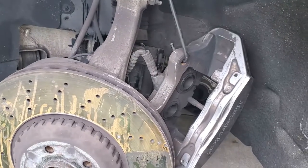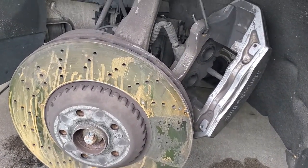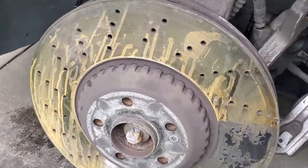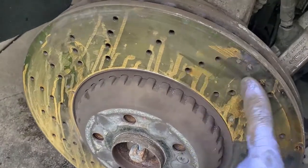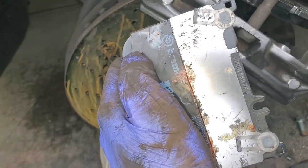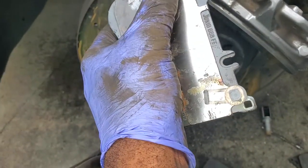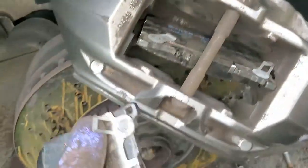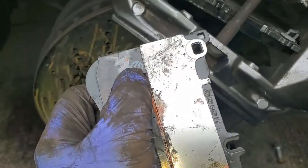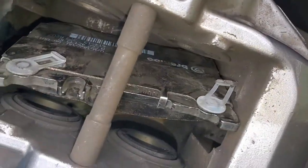One thing I want to note: this side of the wheel doesn't have a wear pad indicator — it's on the right-hand side. The rotor looked wet because I used a garden hose and actually wet the wheel so it looks clean. But one very important thing: you probably want to remove these plastic tabs that are covering the holes — otherwise you won't be able to get the pin to go through them. So let's do them now. This is what the holes actually look like after you remove those plastic protectors. We have to remove the plastic protectors on that brake pad as well.